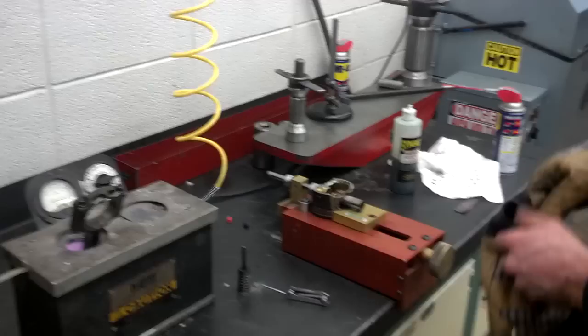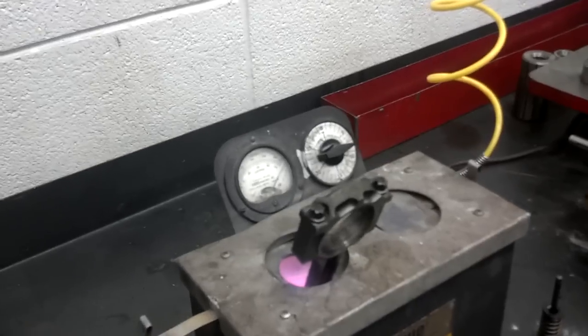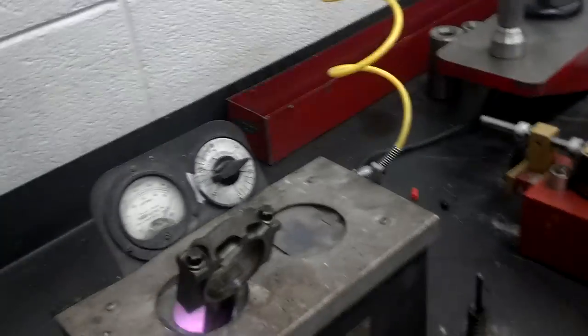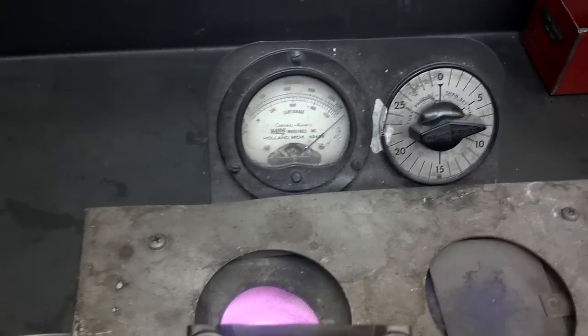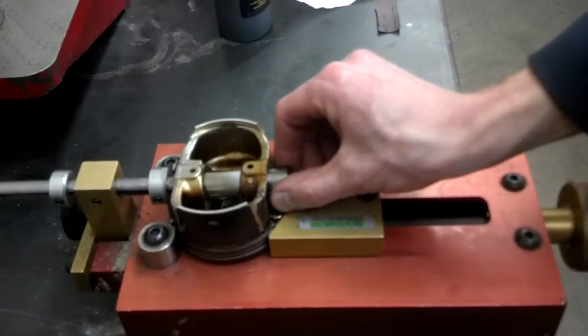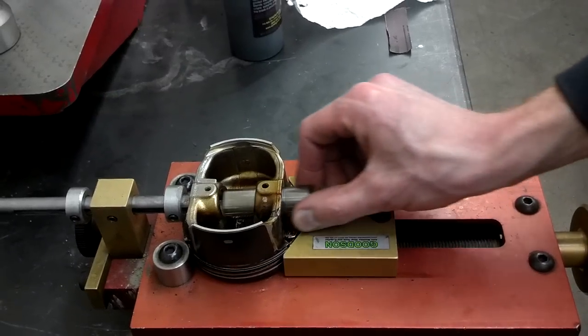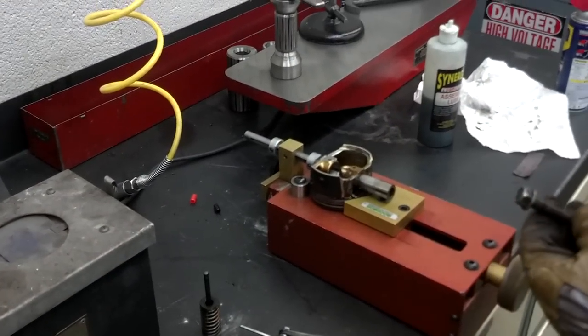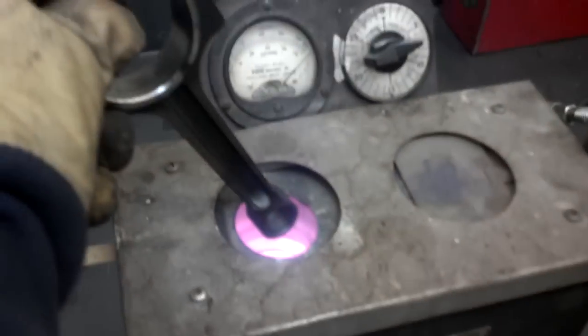The way that you can tell that it's hot enough is that when you pull this connecting rod out of the heater, the end of it will be blue — you can see that it's starting to turn slightly blue if your temperature is right. This is a pretty intense operation; you have one chance to get it right and only about three seconds. We also made sure before we started that this wrist pin could slide smoothly into the piston, and we checked the bore on the connecting rod to make sure it didn't have any burrs in it. If there are any burrs, this won't work either. See how the end has got a blue color to it? That means it's ready.